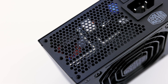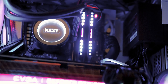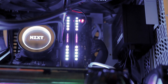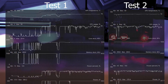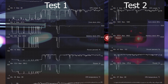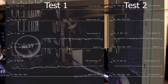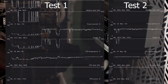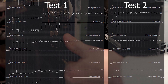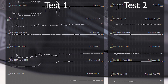I've seen builds that need 500 watts, but this PSU gives you plenty of power to exceed that crucial 400 watt mark. In our analysis we installed a 3080 GPU and tested it by playing The Finals at 144 frames on a 1440p display. The V850 provided our 3080 with a steady power level of around 80% while the GPU was running at about 95% of its capacity — typical for this setup — demonstrating how well the PSU and GPU work together and leaving room for overclocking. The GPU reached a maximum power usage of 380 watts. Even considering the CPU which averaged about 90 watts with occasional spikes up to 120, there's still plenty of power left over.